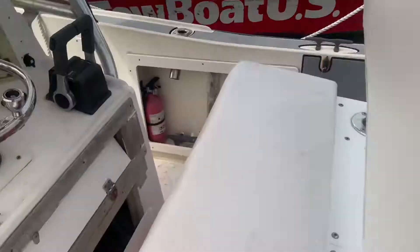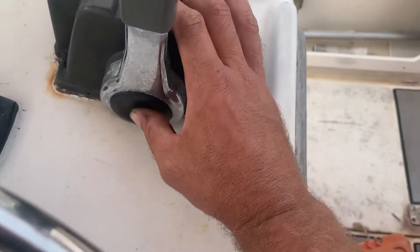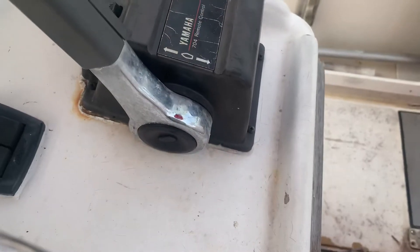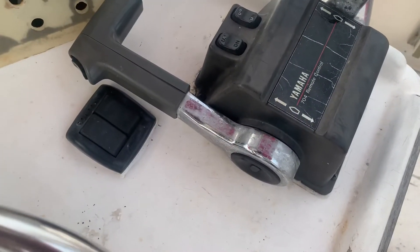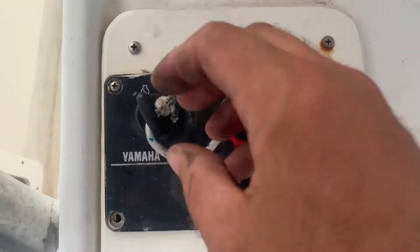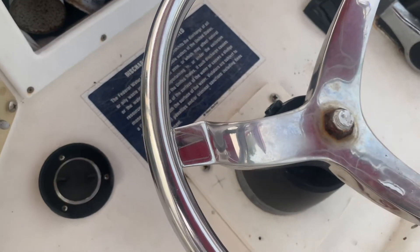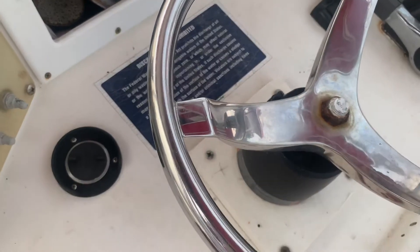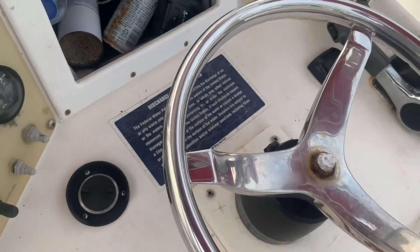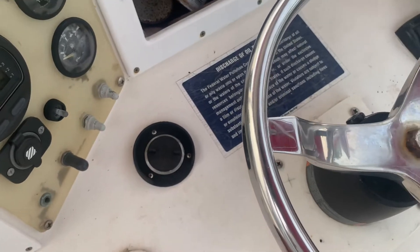Now that it's threaded in, I'm going to go over to the shifter — just like on the other one I showed you — push the button on the side of the shifter to engage neutral, then put the throttle all the way to full throttle so it opens up the air intake. Then hit the key switch and let it turn over about half a dozen times — maybe seven to ten seconds — making sure you get through all the compression strokes and build up pressure on the test.